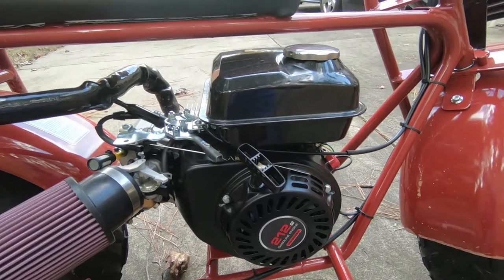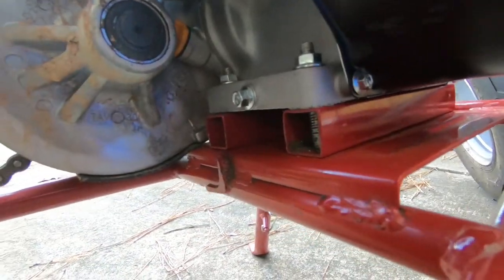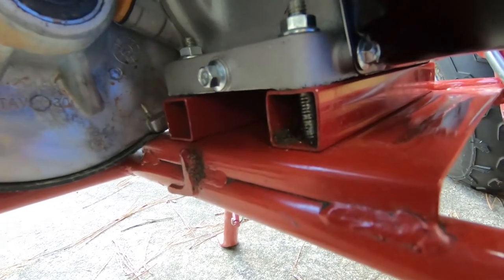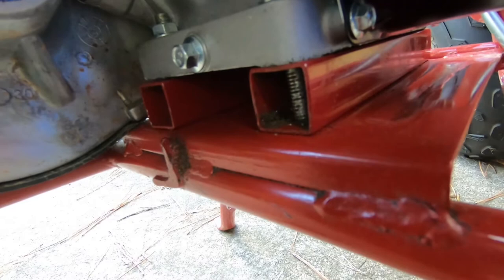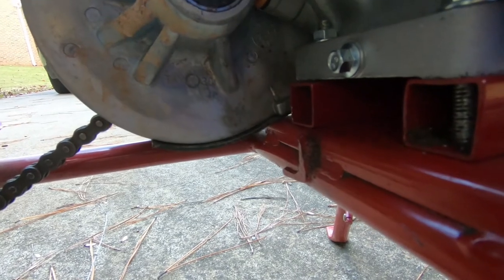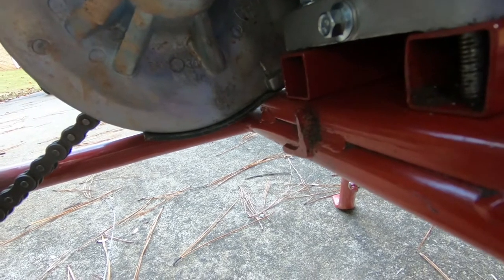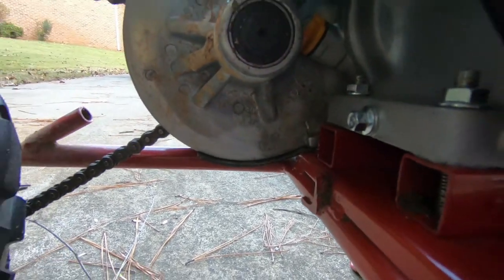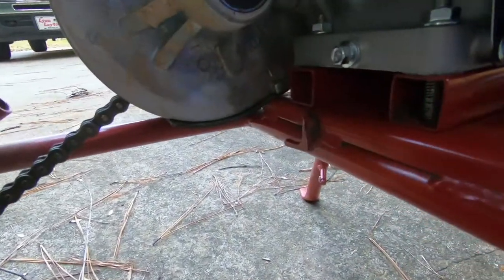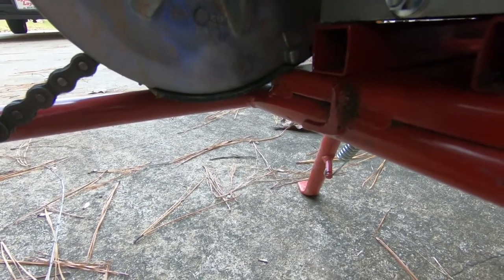Next, I removed the governor from inside the engine — took out the gears in there. Then I raised the engine up on three-quarter inch tubing from Home Depot and found a paint that matched it perfectly, mounting it up another three-quarters of an inch. That got it out of the way, and you can see the back side of the torque converter which I installed — it just fits on there perfectly without having to trim the torque converter. As part of that mod I also had to remove the chain bracket and painted up the ends to make it look decent.